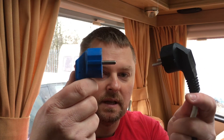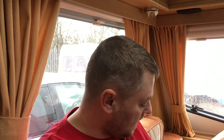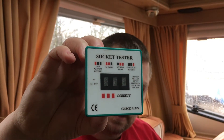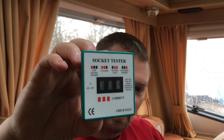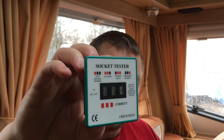So how can you get around this? I did a bit of research and bought myself two of these — they're standard European two-pin plugs. I've got two of them: one that says 'reverse' on it and one that's just a normal one. When I get on site, I put the normal socket in and connect it to an extension lead, and then use this little gadget. You plug the extension lead into it before hooking up to the caravan.